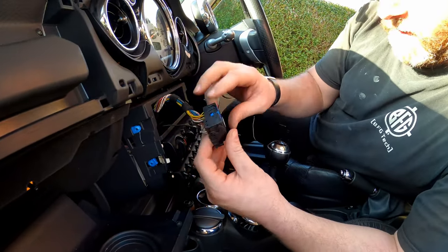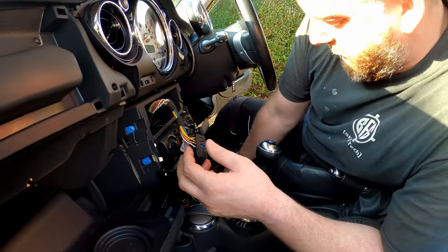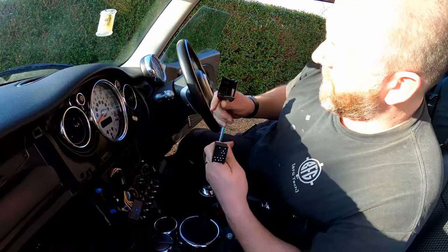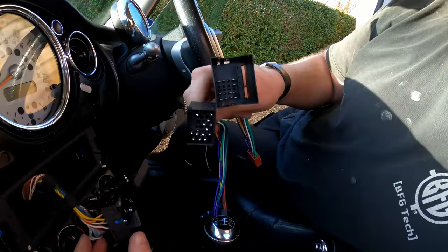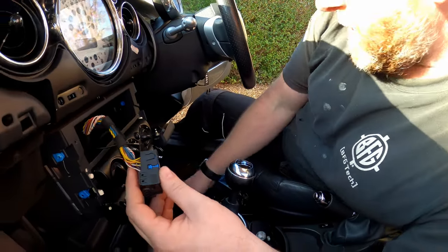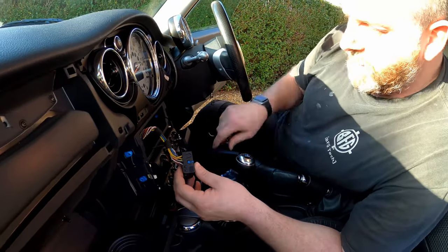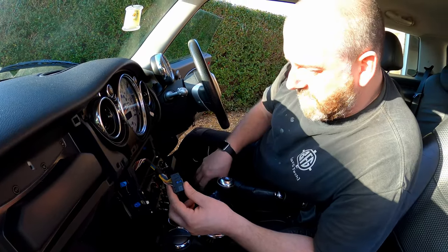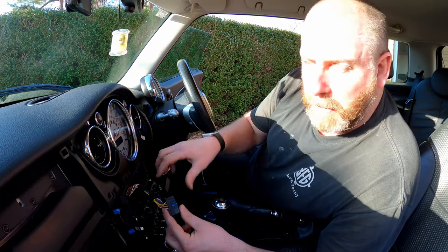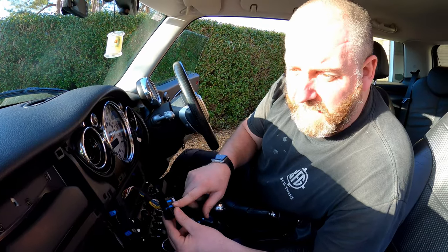What we need to do is look at the actual adapter for the car. Minis have two types — this is known as a round pin and this is known as a flat pin. Obviously you need the one that relates to your car, so I need the flat pin one. The link I'm going to leave in the description for the fitting kit includes both of those cables. Obviously if you want to pull the stereo out first to confirm which one you need, you can, or you can buy a kit that's specific to your car. It was only about 20 quid and it came with the facias adapter, the aerial adapter, all of that good stuff.